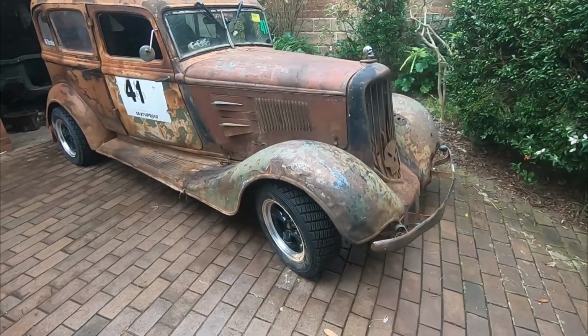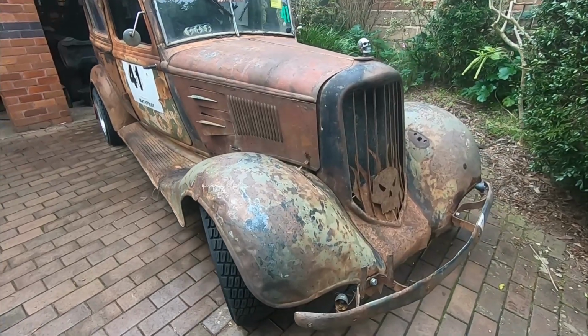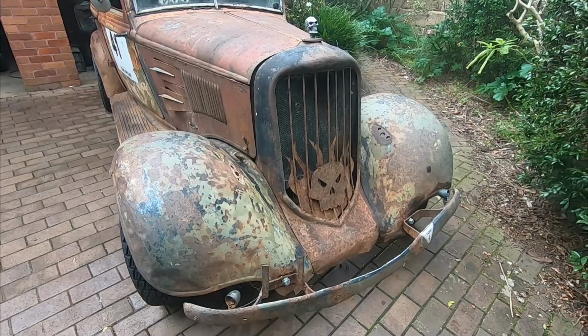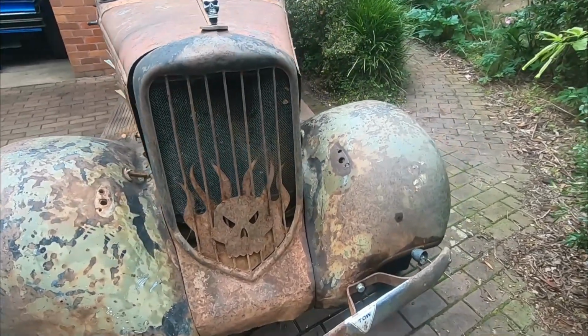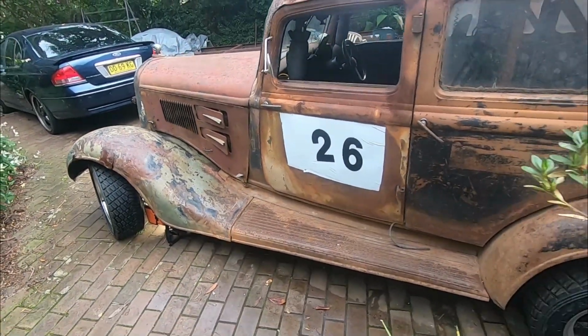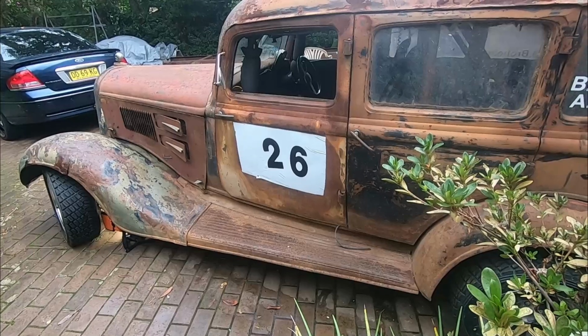That's all going to be pretty straightforward, so I think we'll do the bulk of our repairs outside. Headlight mounts and suspension, of course. But come and take a look at this left-hand side, guys. You may not be able to see it too well, but if you take a look at the circled area, one of our high-pressure steering lines popped right when we were taking it off the bloody trailer. So let's make a start by jacking the front end up. We'll take care of the power steering and that lower control arm first up.